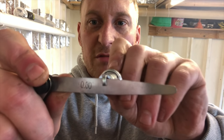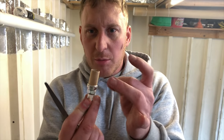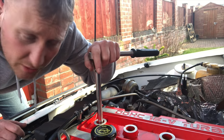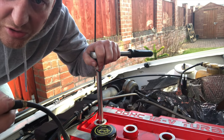There's still a bit of rattle on the 0.7 feeler — they might already be set at 0.7. That would be handy! One down, three to go. Checking all three — they all came set the same. Take that little bit of cardboard off: 0.7, 0.7, 0.7. All four plugs came pre-set at 0.7mm. Let's go stick them in.